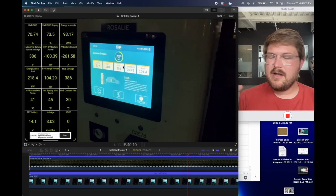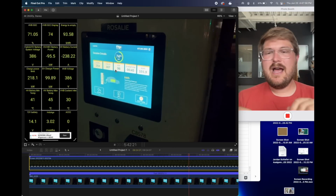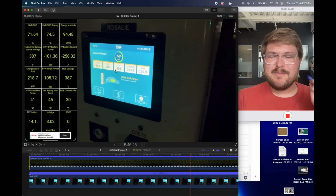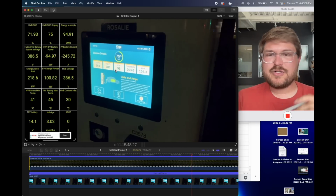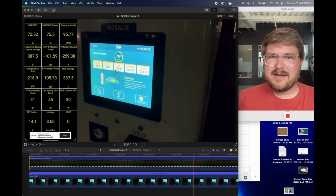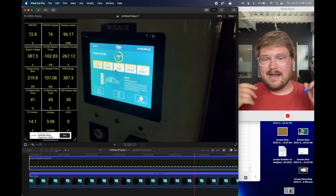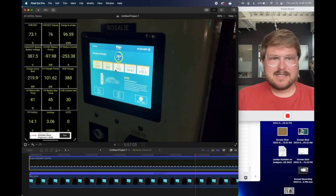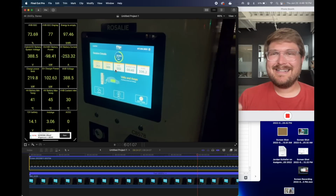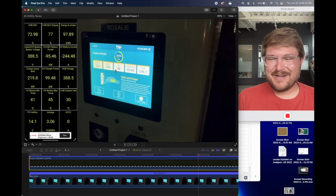This waffling would be my guess, but it pretty much holds 120 kilowatts to 80%. And that's when I would most recommend that you unplug and go. Charging past 80% in this truck sucks. Not as bad as Mach-E, but it sucks. And that's really the topic of what is this truck built for? And it's built for, I believe, really an unladen daily driver, or with some payload in it.